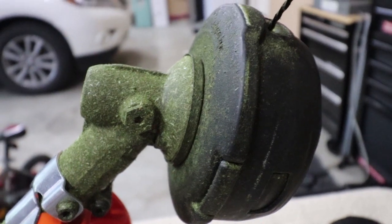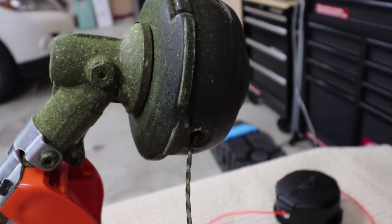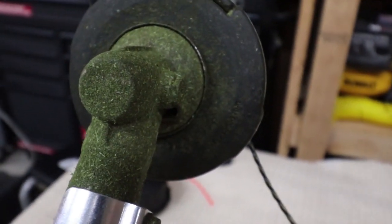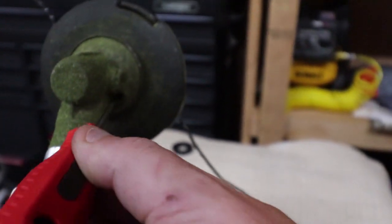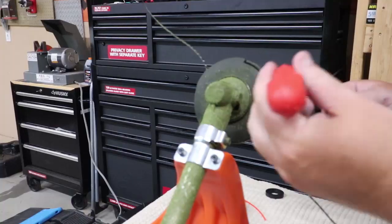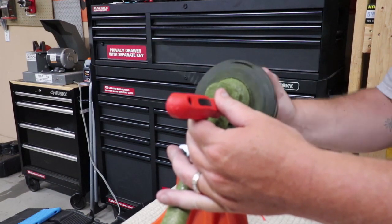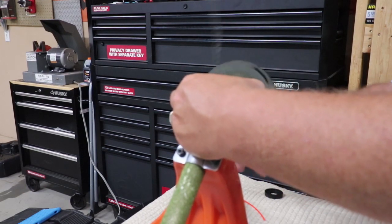As you're looking at this trimmer, this is where you'd fill your grease at. We have the Husqvarna trimmer head on here, and if you come right below that, there's a hole. We're going to take a small screwdriver, stick it in that hole, find where it catches, and then twist it clockwise to pull the old head right off.